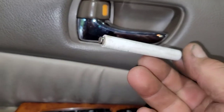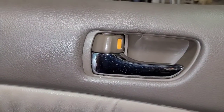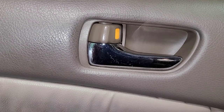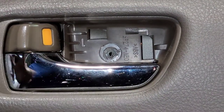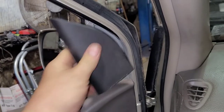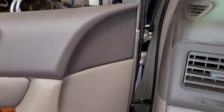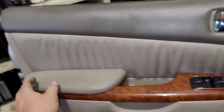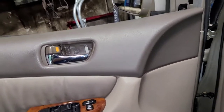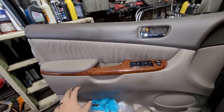So let me pull that off and then we'll go to the next step. That's where the screw went - I already took the screw out, just a Phillips screw, no big deal. Now you've got to pull this upper reveal panel off the inner piece for the mirror - this is usually just a pop-on. Now the door panel itself, there's no screws around the perimeter of it. I believe this has just got push pins that hold it in place, so you're going to have to use a panel tool to pop the pins, and then you always have to lift up on the panel.